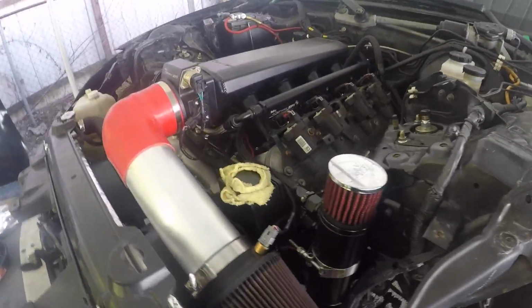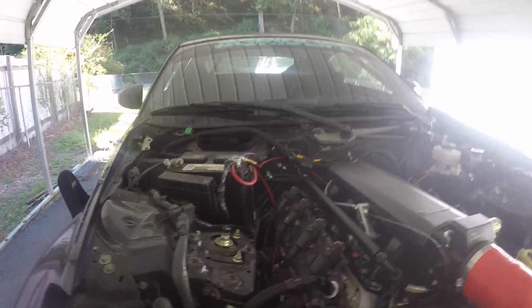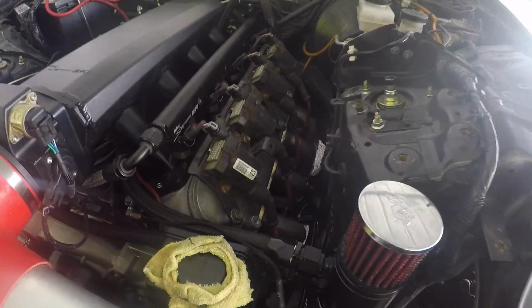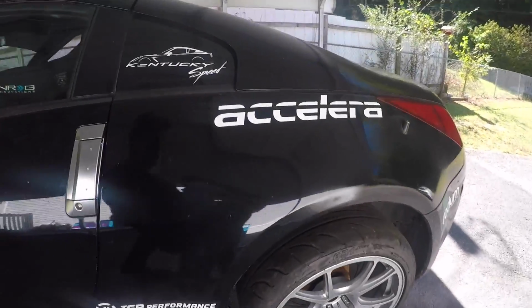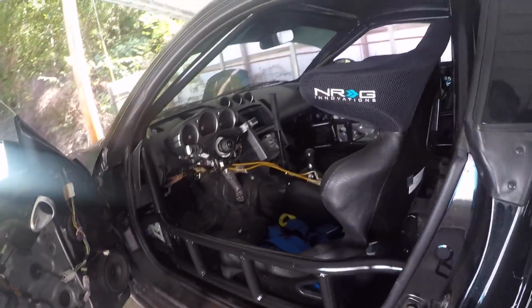God, these fucking power steering lines, I swear to God, I'm gonna call Siki first thing Monday, let's see if they can help out. I think that it's leaking from the fitting itself, the fitting that's on the line, not the fitting that goes into the rack, which is fucking unfortunate. But I've probably gone through like, I don't know, 5 quarts of power steering fluid since grid life.